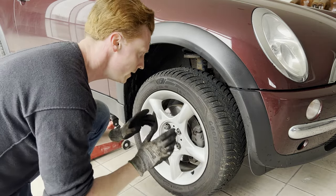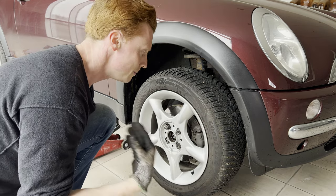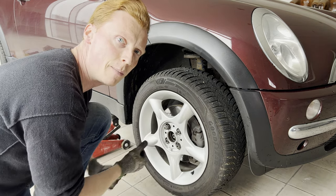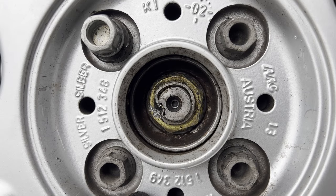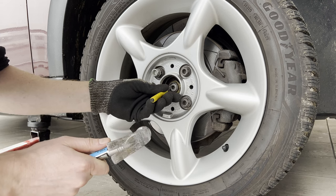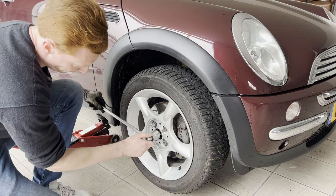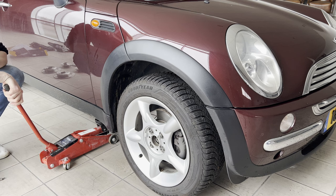I'm not sure if you can see or hear this, but this is why the wheel bearings are worn out. That together with the grinding noise made me sure that the wheel bearings were worn out, and my girlfriend too. As we would need to remove the axle nut, we're going to drop the car down again and then loosen the axle nut before lifting it up again. We'll lower the car, then find a way to undo this axle nut — I'm going to try a punch to hammer it out. We'll replace the axle nut anyway. With the 32, we're going to loosen this one. Now we're going to lift the car up again and remove the wheel.